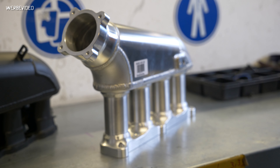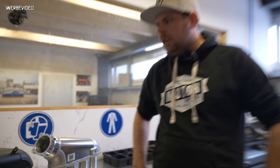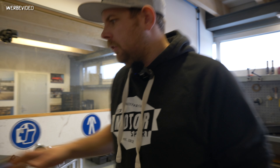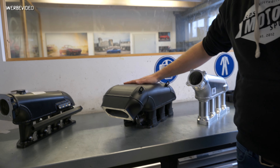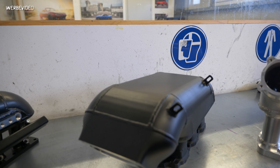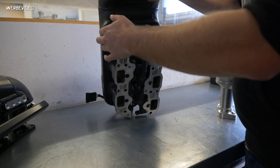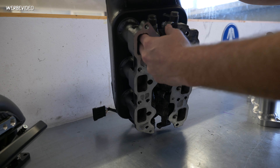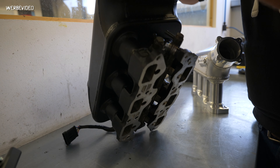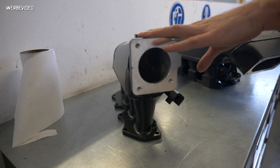There's one which is completely made out of billet, used by Derek Rockwell, and then we have our own one. We saw it and it was pretty pricey, and to get it over here it's much more pricey, so we thought okay, we'll just make our own. What we have here — the video is already out for the V6, so you saw the intake manifold from Gizelworks for the V6, which is completely hand-built. On this one, because it's a one-off single product, we are using the stock runners down here, we grind them so they match finely, and Lennart from Gizelworks welded all the stuff on top. These are brand new intake manifolds.